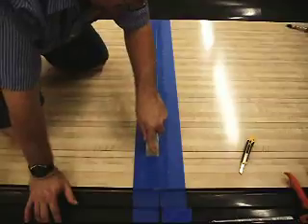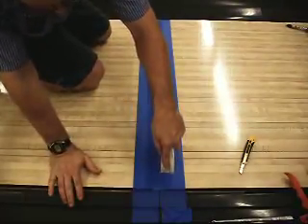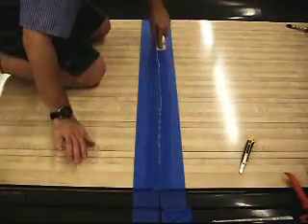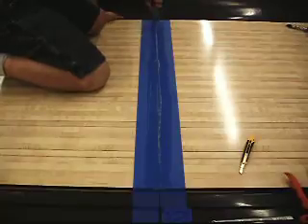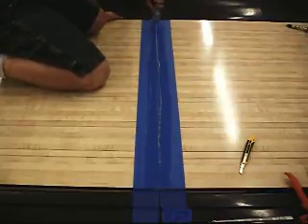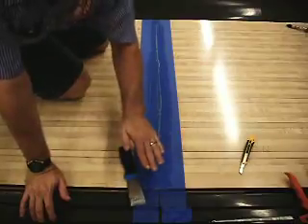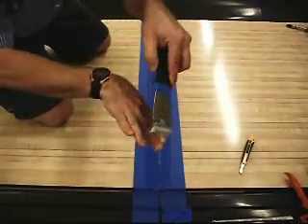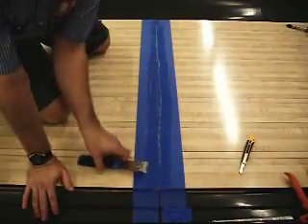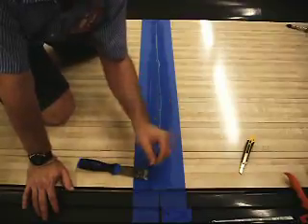Now I'm going to do the other end, doing a little bit more off the front here as well. Then I'm going to take my knife and clean this seam off. Run it across the high edge and the lower panel, trying to scrape it clean. If you just leave it with a bunch of humps and high spots, when you go to remove the tape it will be so thick it won't really shear off and tear off clean — you'll get big chunks that try and pull off.